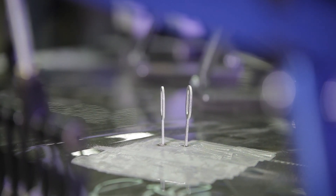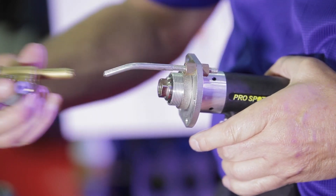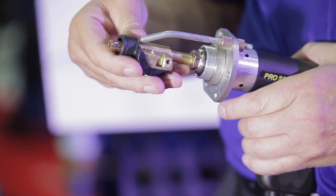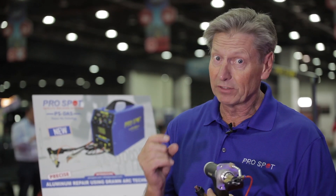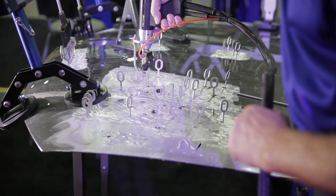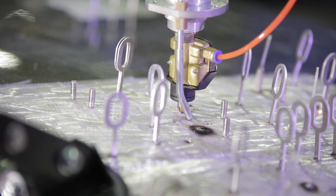It's also very good for using studs. We can use a different adapter that we insert here and then we can use threaded studs. Threaded studs are going to be key for aluminum repairs. We have more and more aluminum vehicles on the market, and replacement parts may not have the studs, so you're going to see a lot more aluminum stud welding in the collision repair environment as well.